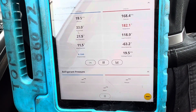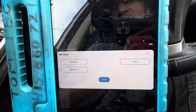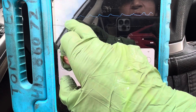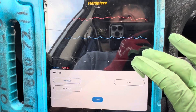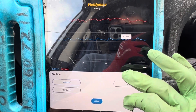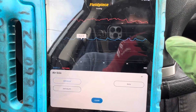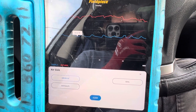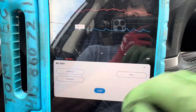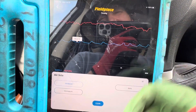We're at 197–200 psi and it's cycling because we're reaching minimum temperature. Right now the temperature out of the dash is 43 degrees — the clutch is kicking off at 43 degrees with 500 grams. But when the customer had 222 grams in there from using the can, 39 degrees Fahrenheit was coming out of the dash. Run that mind-blower through your head.